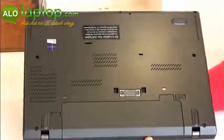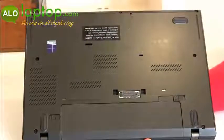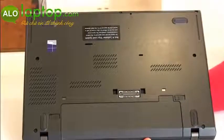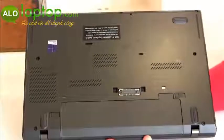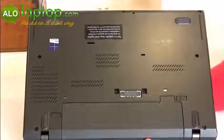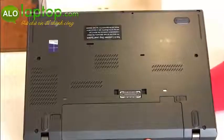The wireless card is socketed. You have your choice of Intel single band Wi-Fi 802.11 BGN or Intel dual band Wi-Fi AC modules. As always, Lenovo and BIOS whitelists only certain wireless cards are allowed. So if you want to upgrade yourself after this, you're probably going to have to pick one of the cards that Lenovo actually ships the machine with.